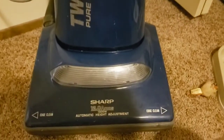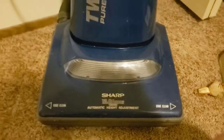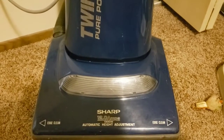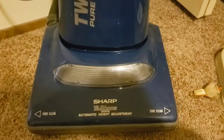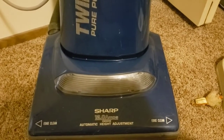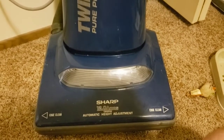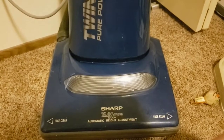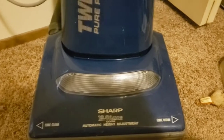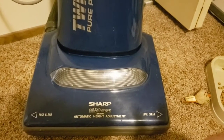And I should mention this, there's another YouTube channel, House of Vacuums, and he pointed out that in Sharps especially, you'll see the metal holders in the carbon brushes actually slide forward, and over time they can slide into the commutator on the motor, and they'll actually scar it and destroy your motor. So for those collectors out there who have Sharps, open it up, take a look at it. You should take your carbon brushes off and push that metal holder back into the plastic housing.